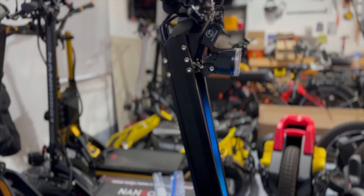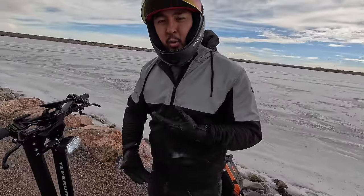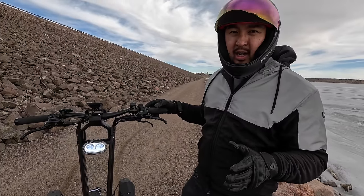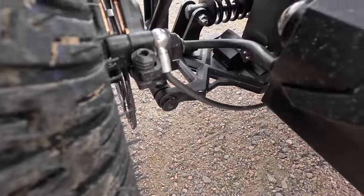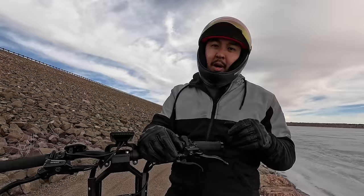The front light is bright but extremely narrow — I'd like a wider throw. This type of narrow light is on a lot of scooters and it's pretty bad. The bottom cable has also created an issue with the brake lines in the rear, which have gotten pinched in two areas. The rear brakes still work, but I have to pump them — on the first pump I can fully compress the lever, and on the second pump it starts to build some pressure.